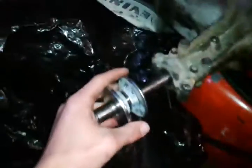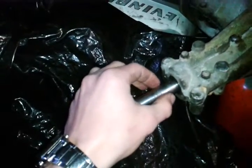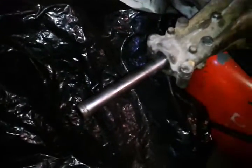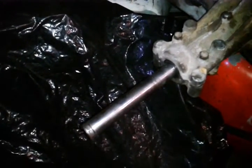So here we go. Here's my transaxle. This is just a mock-up right now. I'm going to cut the shaft at about here and put 2 notches in it. I ordered 2 steering U-joints. We'll see how those work out, whether they'll hold up in this application or not. I'm not sure, but we'll find out. They're 3/4 inch inner diameter, so they should just slide onto the shaft.